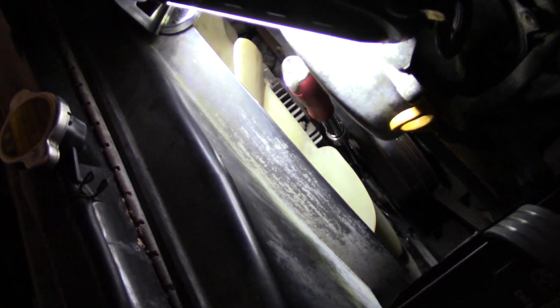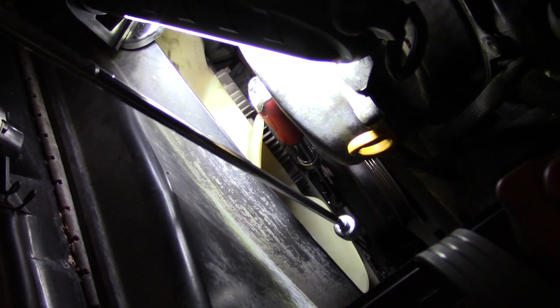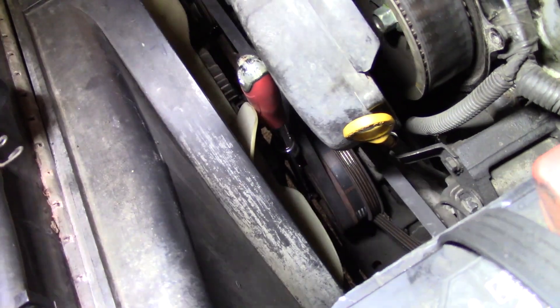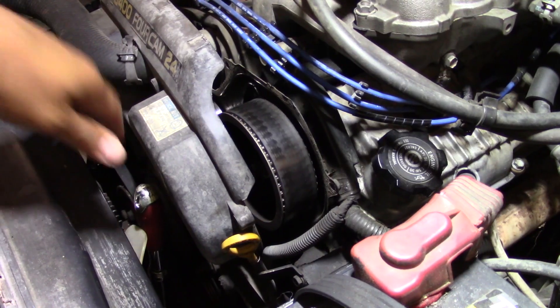In order to get a full inspection, you're going to have to rotate the engine. You always want to rotate the engine clockwise — that's to your right if you're looking at the front of the vehicle. You rotate the engine from the crankshaft bolt. I have a 19 millimeter socket placed on the crankshaft bolt and I can squeeze it in from the top of the motor going down. You don't want to rotate it counterclockwise because you may impact the tension on the belt and upset your timing.